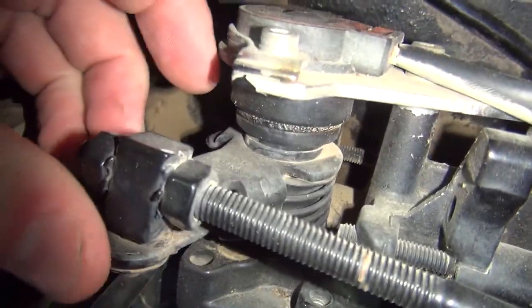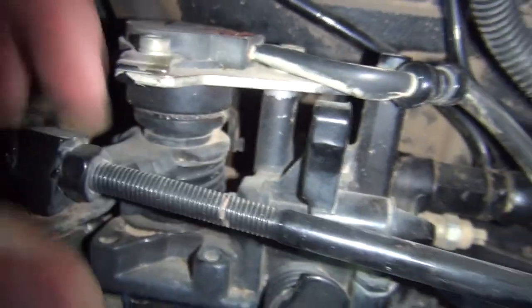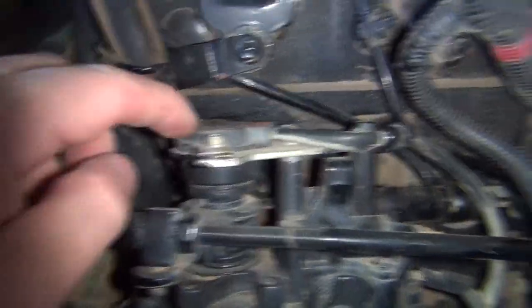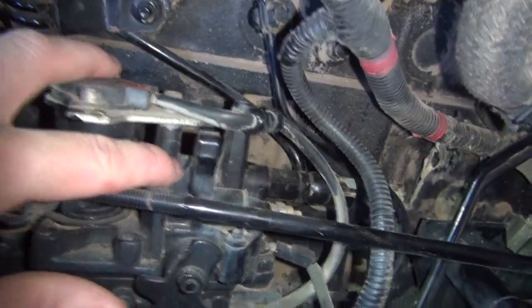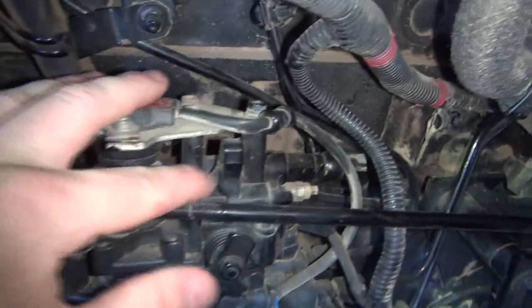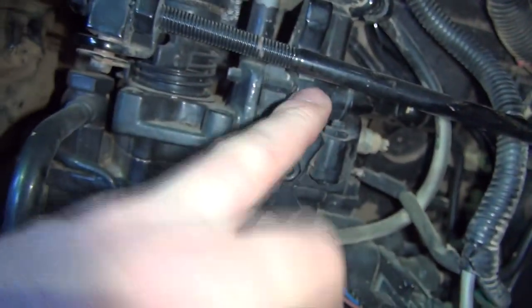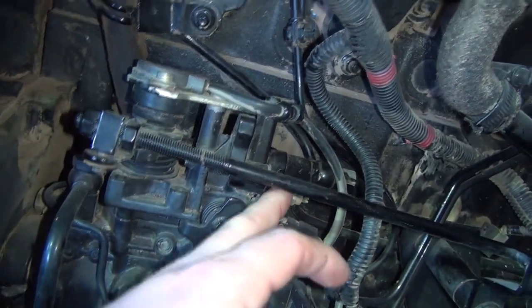If you look here you can see right there — see where that's touching? When I let off, that's your idle back there. You can see where it's touching the screw. It's back in behind there; it's kind of hard to film. You may have to pull this throttle position sensor off — I did not have to do this. I went through right here. You have to get the cap off this screw, and there will be one on that back one too. You don't want to take a hammer and go beating on the injector pump because there's only a little ear on the side of it and you can break that ear off.